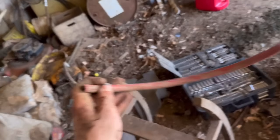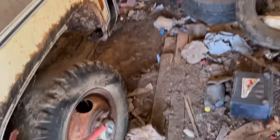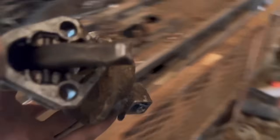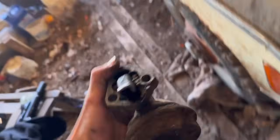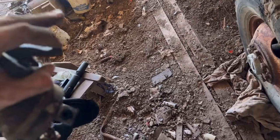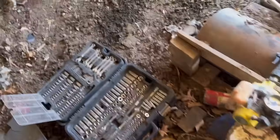I was able to find this. It's laying over there in that pile, so I guess I will use this, hook it up to the fuel line, then route it back up here. But the fuel pump is off. So now I just gotta make sure whenever I put that back up in there that the rod sits on the new one right here so that this pumps. But let's go ahead and get the new one. Toss that over there because God knows it's bad anyway.